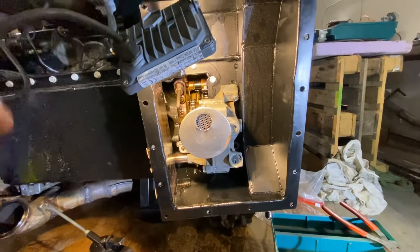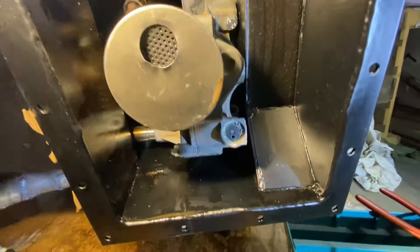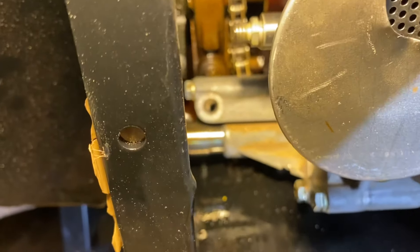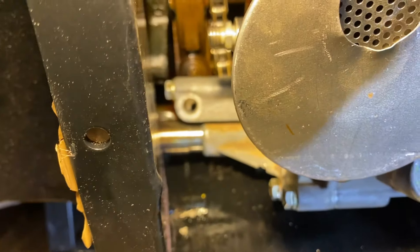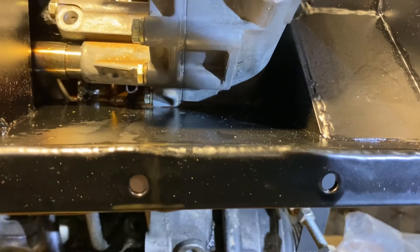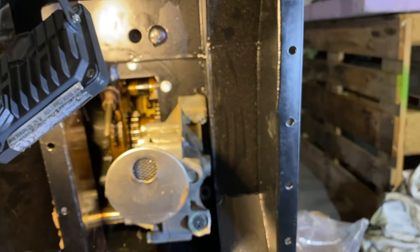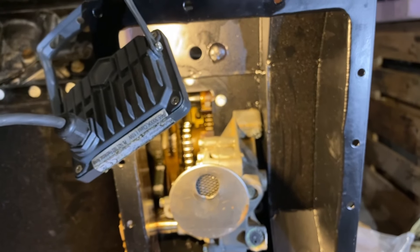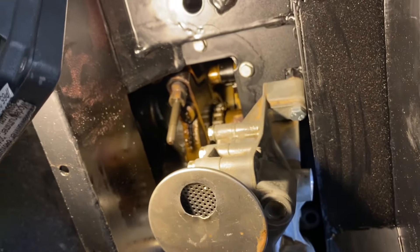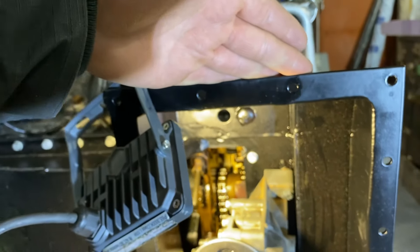As you can see here, I've got the oil pump into the oil sump but the holes don't line up — you can see it doesn't line up because it hits on the underside here. So I'm trying to remove more material from it and see if I can get it to fit. I'm also going to show you what to do before you put on the oil sump itself.